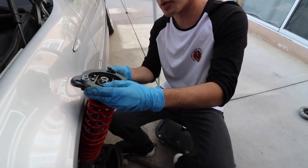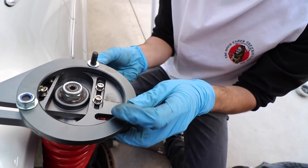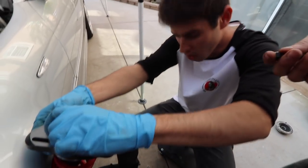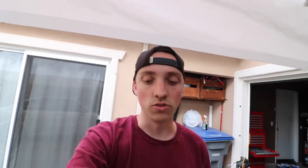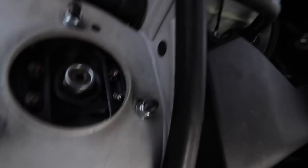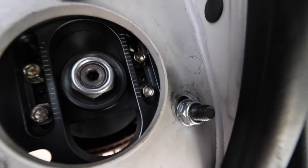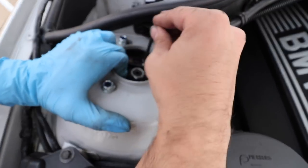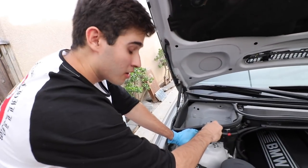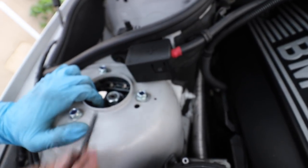Now what you're going to want to do — it's able to play around — you're going to want to remove these nuts, which is going to go right here. We're going to be replacing the OEM nuts. So we just finished up the driver's side of the camber plates and we have everything bolted down. There are the three bolts here and you can see the plate down there. Now we're just coming over to this side here, finishing up, just adjusting the camber on this side. Hopefully everything's okay, but we're going to be testing it — we have to put the wheels on and then jack it down to see where it sits.